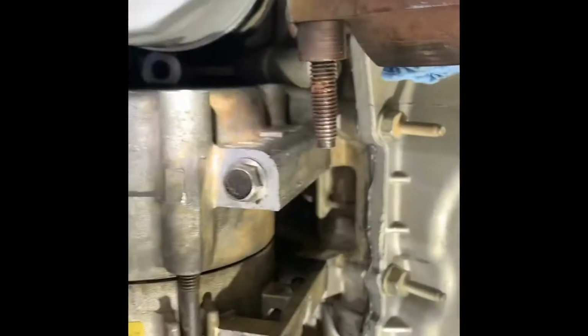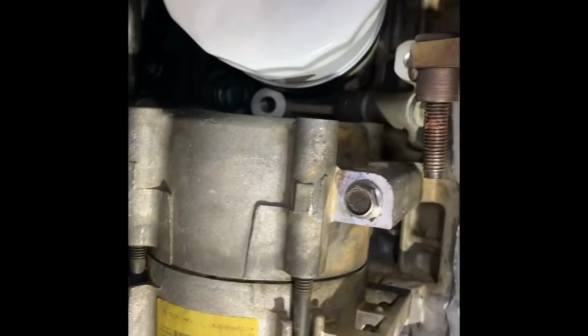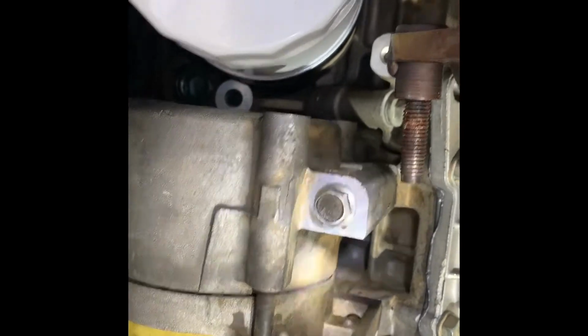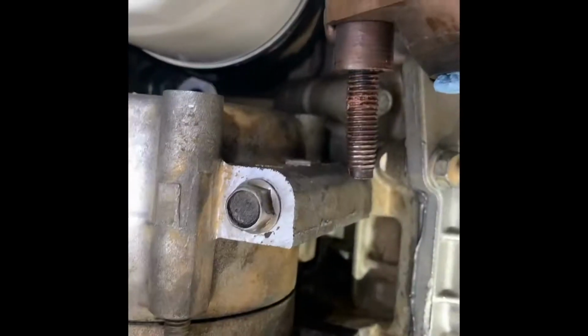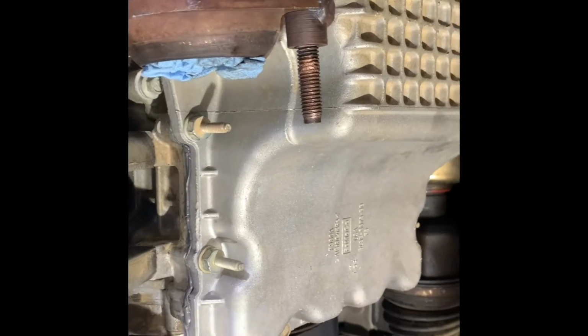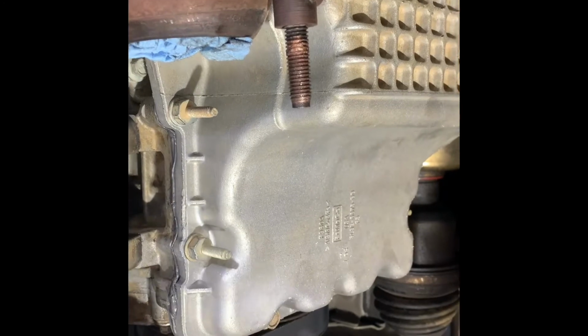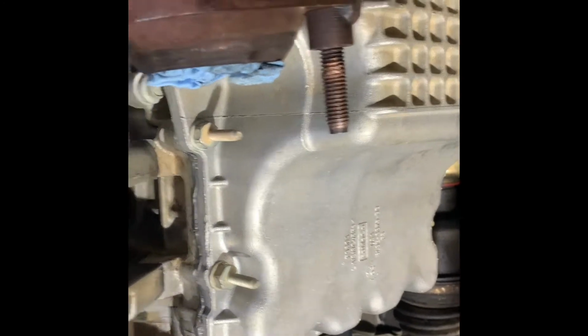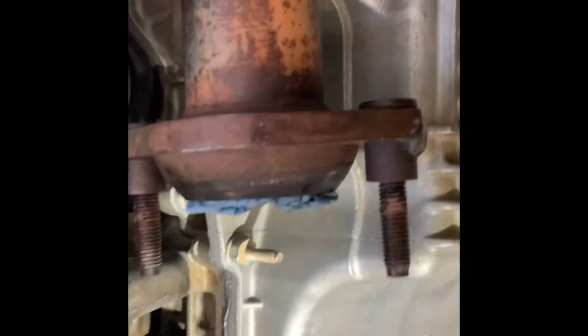So to remove this exhaust manifold, you have to bring down this compressor holding by these 3 bolts, long bolts, 1, 2, and then 1 there. So you don't need to remove the lines, the connections. You just need to bring it down and seat it on a chair maybe, so it won't be putting strain on the hose connections.